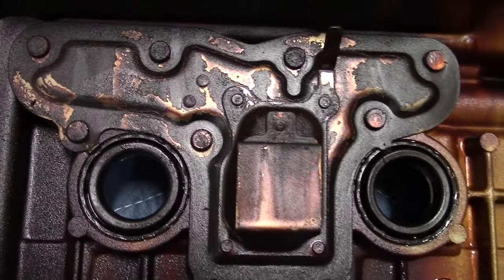Be careful not to dig too much — you don't want to scuff and scar up the valve cover. Repeat this process for both valve covers: you'll have three seals on this valve cover and three on the other. Next, I've removed the old grommets from the valve cover using a flathead screwdriver and a little hammer, knocking those off gently. Also remove the PCV valve at this stage. The old seal just pops right off with your fingers — pull up, pull off, and remove.